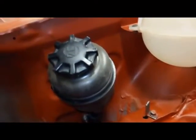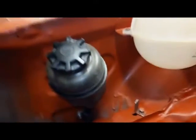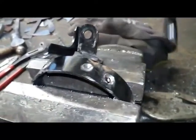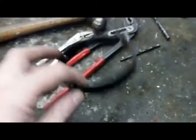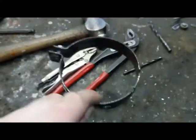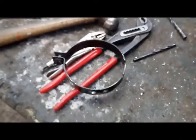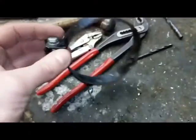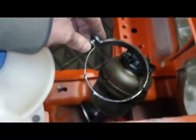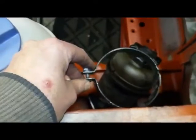The bracket I've got is off the E46 as well. I've started drilling and chopping it. This is the E46 bracket in the vise — it has two legs on it. I've drilled out the spot welds and knocked the two simpler sub-brackets off, which I would weld onto the car and leave the main bracket removable. That way I can use a nut and bolt to take it in and out, which makes painting a lot easier.